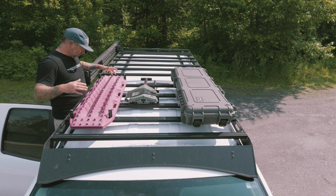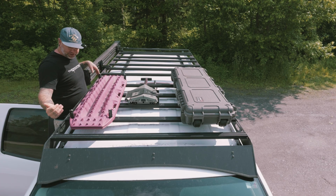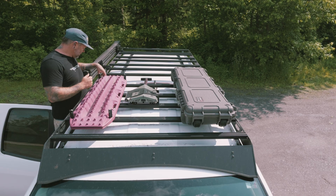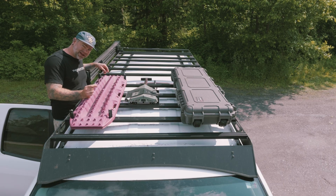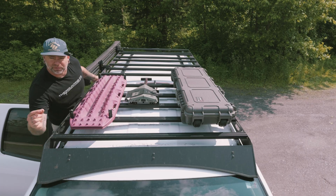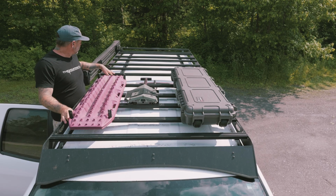The Little Bear roof rack was a little bit harder, especially just doing it myself at home. I had quite a time getting it centered because every time I'd get it up there, it'd kind of slide off. But like everything, you want to measure until you actually know where you're going to cut or drill, in this case. So I measured multiple times. I probably should have gone back a couple millimeters, a centimeter or so, because the fairing is up at the top point now, and on the corner on that side, my windshield wiper just barely touches it. So that was my fault. I should have come back just slightly. Other than that, it took a couple hours to get this one installed, but super happy with both of them.